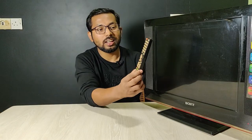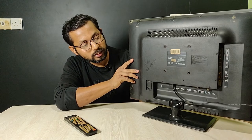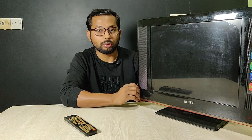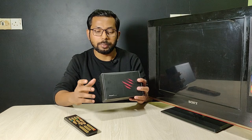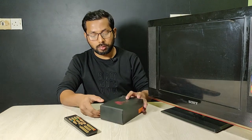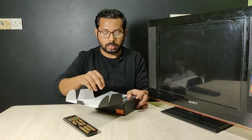As you can see, this is the remote of this television — very old. As you can see, the last point is it has an HDMI port and also a VGA port. If you are going to make an old TV smart, you must need an HDMI port. Luckily it has one. So today I'm using this device called the TX3 Mini — it is an Android TV box — to make the old TV into an Android TV.